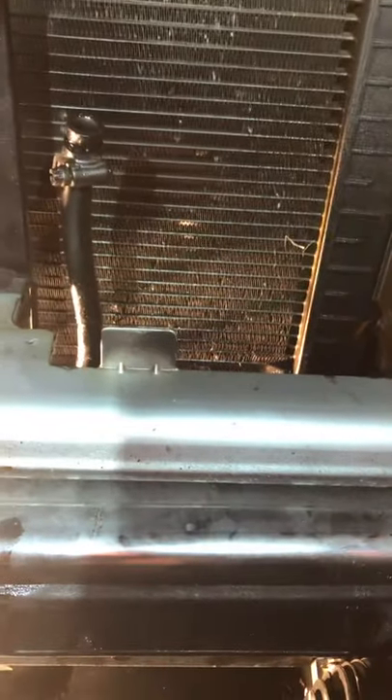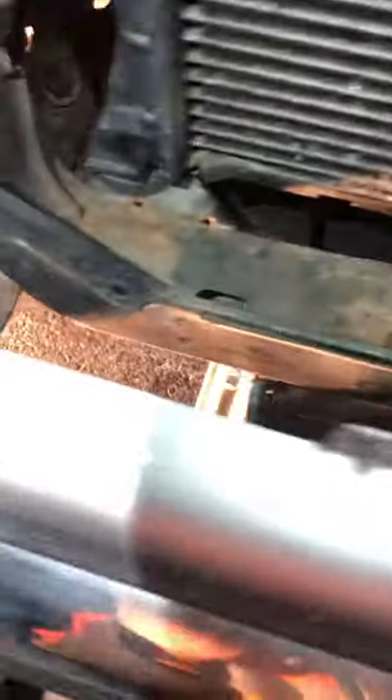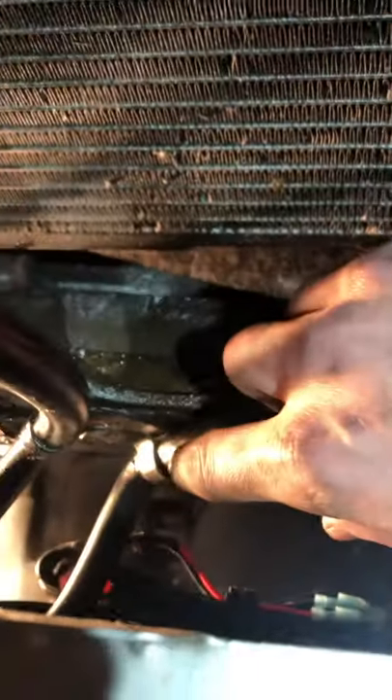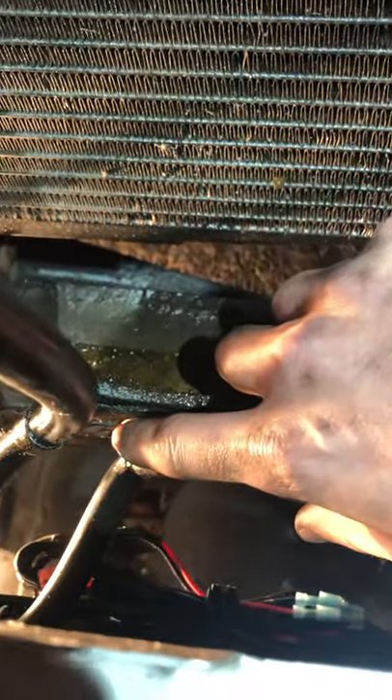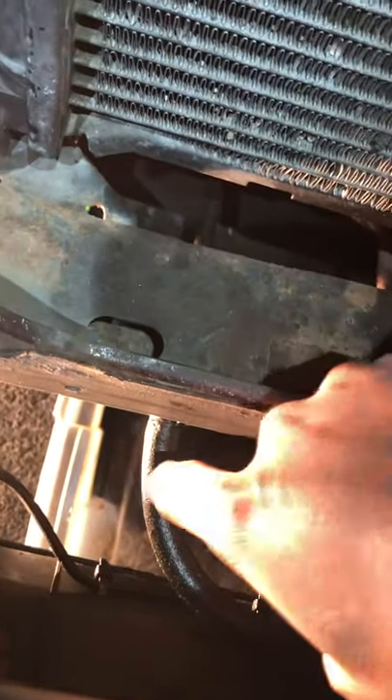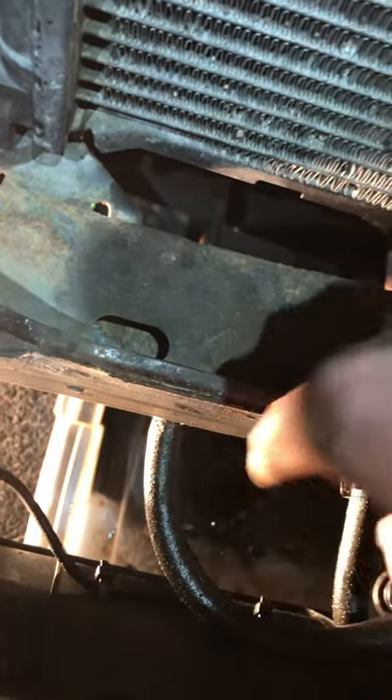I'm going to take it one step further because my truck is leaking all the way down. Ignore that wire mess — I'm going to clean that up later. But these rubber lines go from the cooler, follow down to a bracket right here that holds them still, and then continue down to hard steel lines. Directly underneath this bracket are more hose clamps. So this is where the rubber lines of both of them meet the hard lines, and mine is also leaking there.